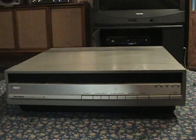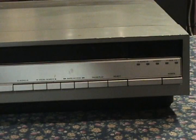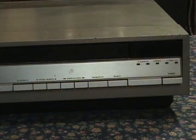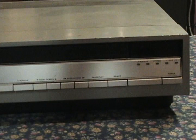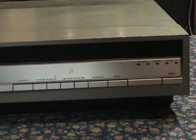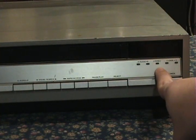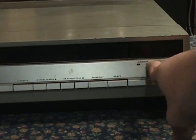So right here we have the SJT 200, which is a whole 100 up from the last player. Something interesting about this player is that it is the first stereo video disc player, so you can have all your video discs in stereo. The controls on the front look pretty similar, except there's a couple new buttons and displays. On the left you have the audio AB button — I guess if you're switching back and forth between audio tracks, maybe there's commentary on one part and regular audio on another, which was common on early laser discs. Up here in this corner we also have audio indicators for A audio, B audio, and a stereo indicator — so it can detect if your discs are stereo or let you choose between tracks.